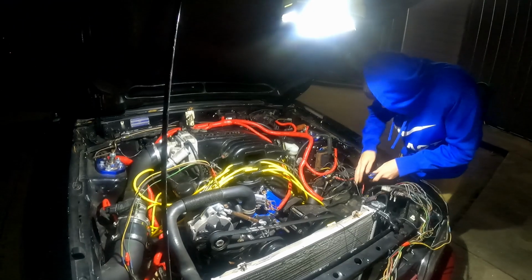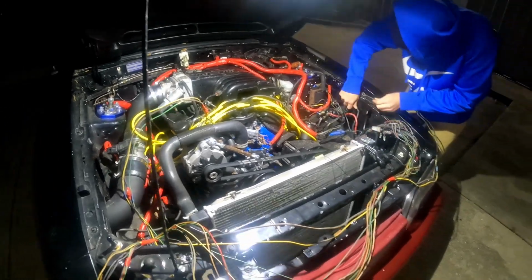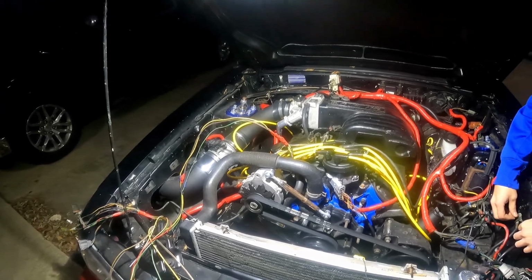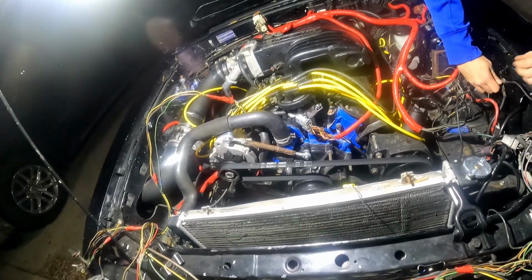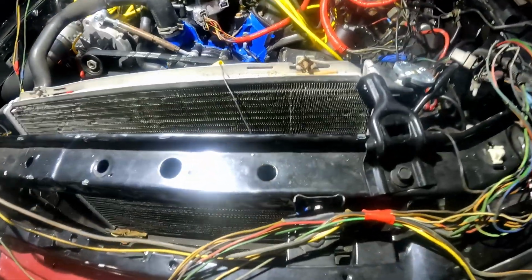And so the main issue is not the battery's parasitic drain, because it does still crank over for a good while, but it's still no starting. Usually after it gets up to temperature. How many grounds do you think you can smash into one? Get a wrench for that. There's another ground.